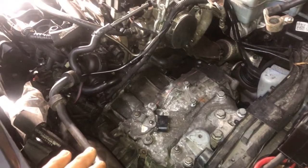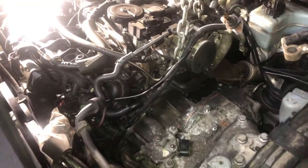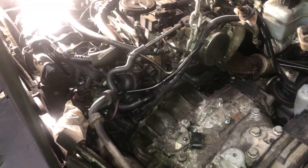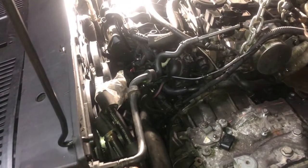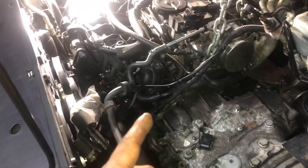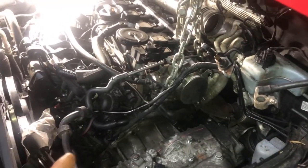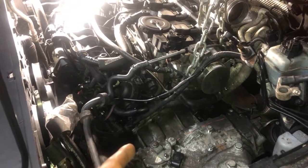I hope this can help somebody, because this was driving me crazy. I couldn't figure out why the car was giving misfire on all cylinders — good compression, good coils, good spark plugs, no vacuum leaks, good fuel injectors. That's how I figured out that on these 2.0 turbo cars, if the rear main seal is leaking, it will give you a problem like a vacuum leak — that's why the car was hesitating and misfiring on all cylinders. I'll show you where the leak was once I remove the transmission.